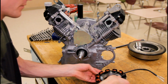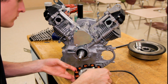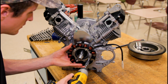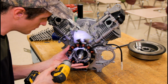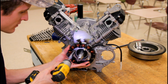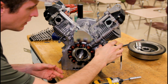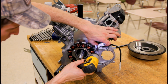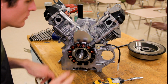What we're going to do first is bring this guy up. We're going to get the right socket going here. He's going to go up so the wires can come out like that. We're simply going to start one fastener, do a little bit of adjustment so we can do a second, and a third, and a fourth. Then this locks up on there really nice. Don't forget, this last little guy goes on and keeps him from getting eaten up by the flywheel. So it doesn't pinch it or anything, it just holds it like such.